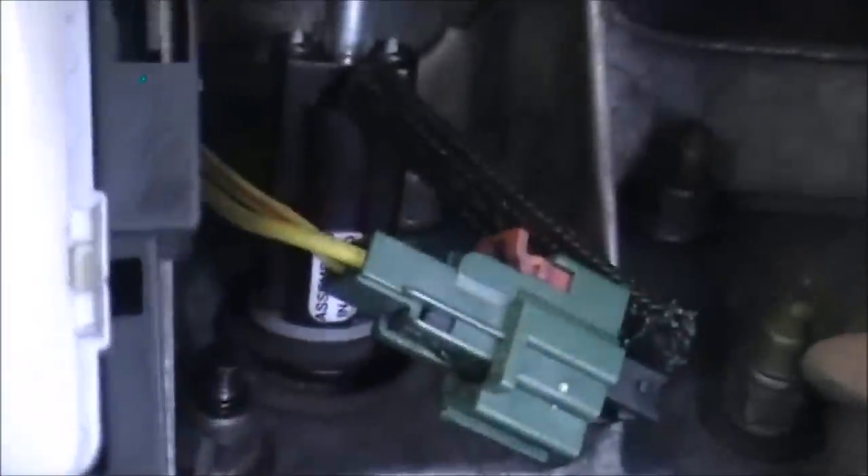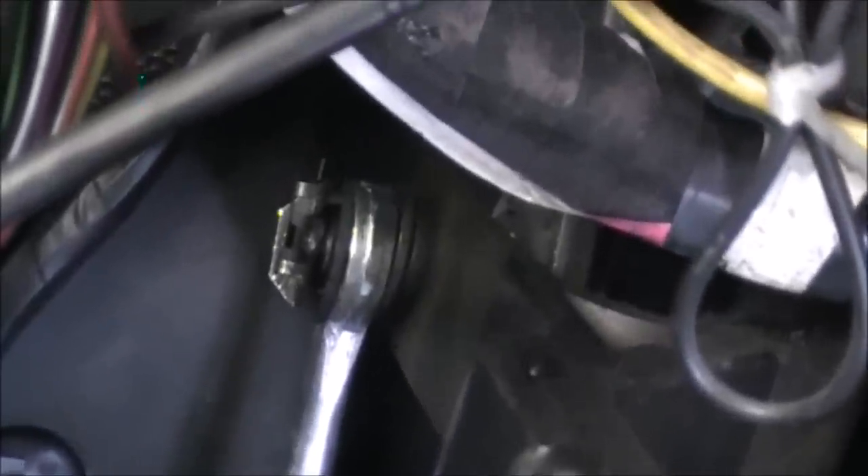Because of that, I have to bypass it because I'm not quite sure how I'm going to go about replacing that shaft. I found the parts on MoparParts.com, and finding the part is not the problem — the problem is getting the thing out. It looks like I have to drop the steering column to disengage the pedal assembly from the firewall and pull it straight out to replace that pin. In the meantime, I had to disengage the neutral safety switch.